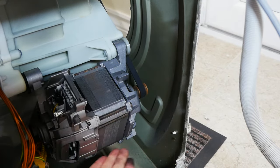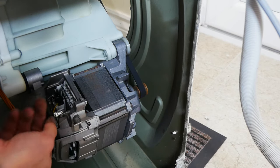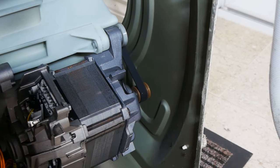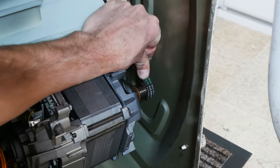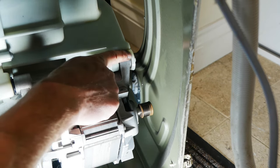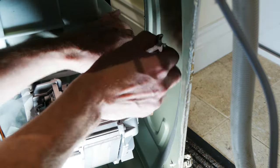There was another brush around the other side of the motor. I'm going to take the motor out so I can show you that one being replaced — reaching behind is quite fiddly, and if you haven't done it before, something could go wrong with the electrical connection or the direction you put the brushes in. To remove the motor, you can see the belt on the electric motor — you just push it and turn it at the same time until it comes off the end of the drive. And now there are two 10 millimetre bolts that hold this motor in place.